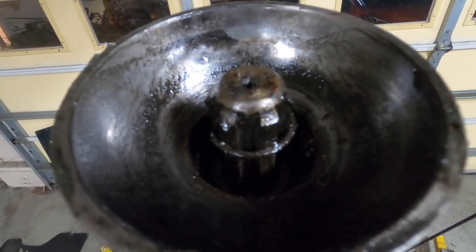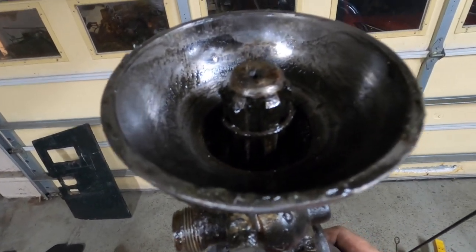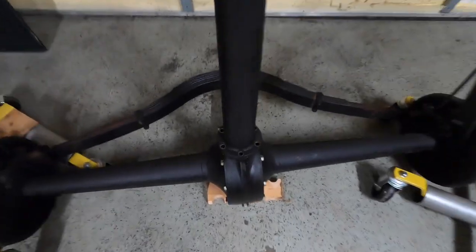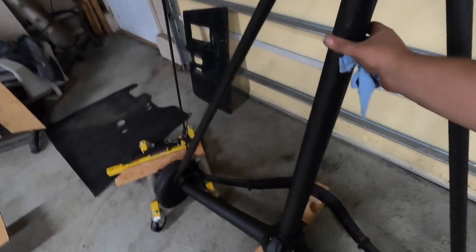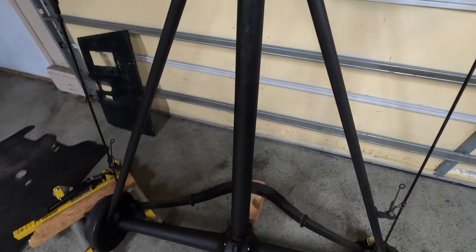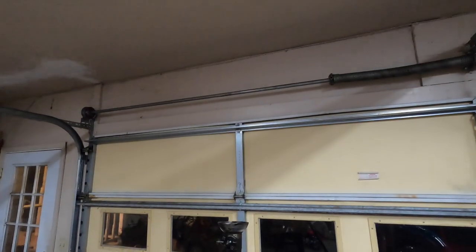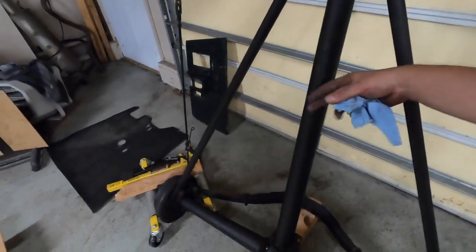Here's a slightly better view of that clip — I've got it pulled up and out of its spot, ready to pull off. I was able to get it with just a couple of Harbor Freight picks, got it wrapped around it and pulled it straight up. With all the torque tube bolts removed, the torque tube should be free — as you can see it spins nice and easily. I'll be pulling this off next.